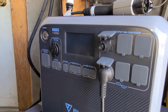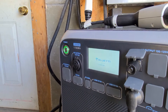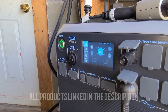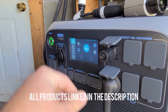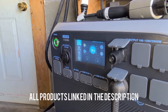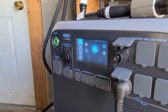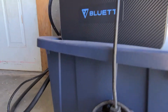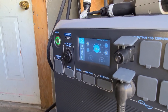The first thing you've got to do is turn on your Bluetti — it'll power up. We have a bonding plug here just so we don't get any ground faults when we try to plug it in. It basically fools the floating ground into believing that it's actually fully grounded. We have a Delphi EVSE that came with the car; it's 110V.